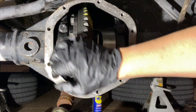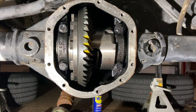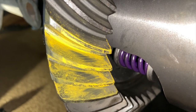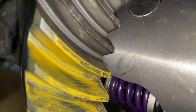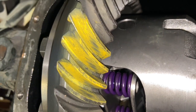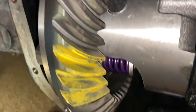Okay, I did get a pattern but it's a non-favorable one. That's a little better. From one side it looks kind of centered and in the middle of the tooth, so that doesn't look too bad. But on the other side it looks a little not so centered. I'm going to have to look at the guide to see which side is the drive side and which is the non-drive side. This is my first time setting this up — it doesn't look terrible, but I'm going to look at the guide and see what it says about tooth patterns.